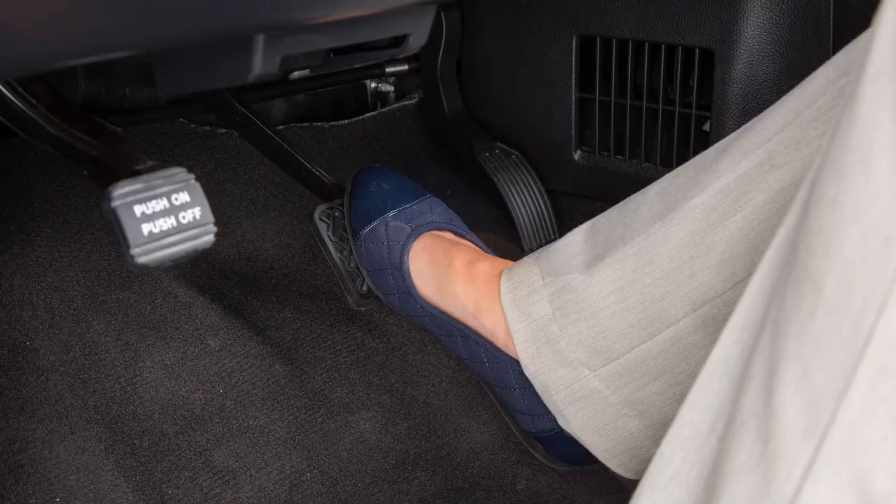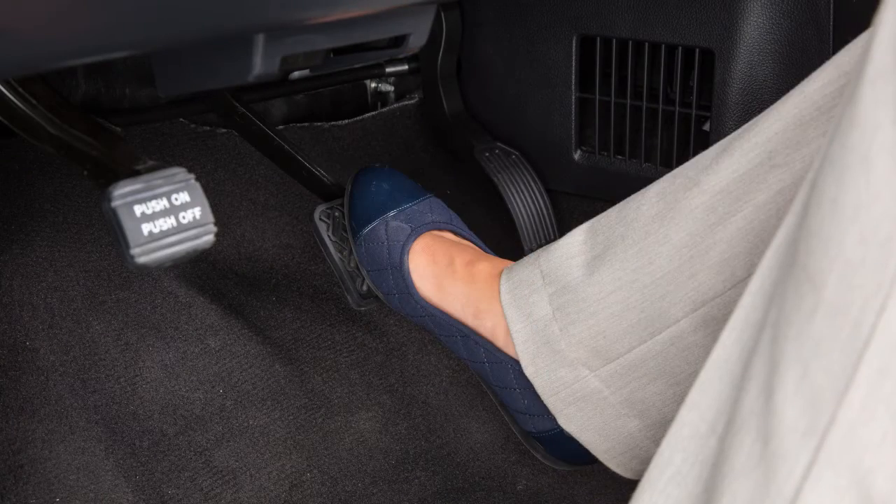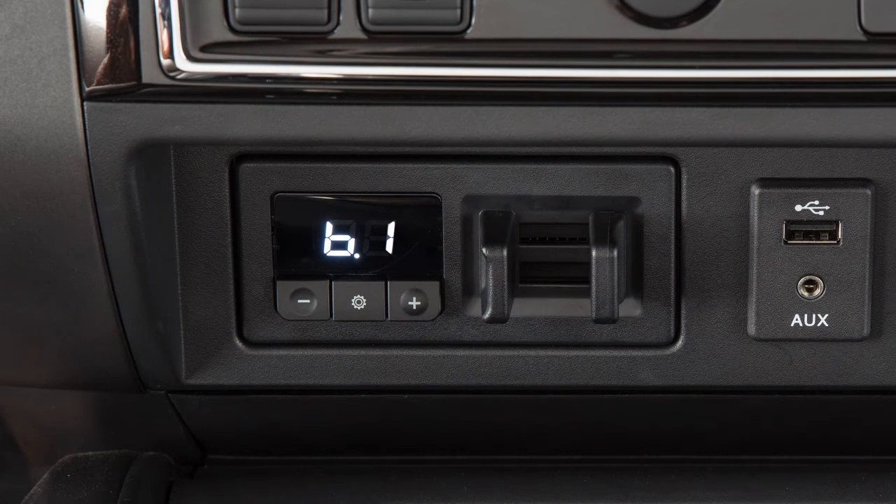When the driver presses the brakes with the boost setting at 0, power to the trailer brakes starts at 0 and increases as the vehicle and trailer slow down. With the boost setting at 1, the trailer brakes start out at 14% power and increase as the vehicle and trailer decelerate. If the boost is set at 2 or 3 during a braking event, the power automatically starts out at approximately 25% of the power setting and increases with deceleration.